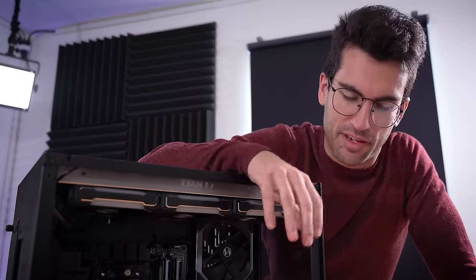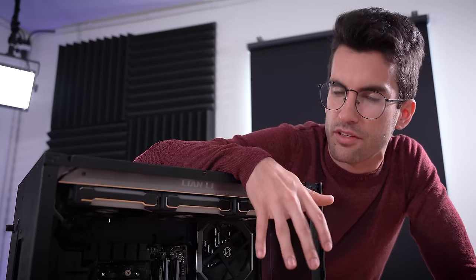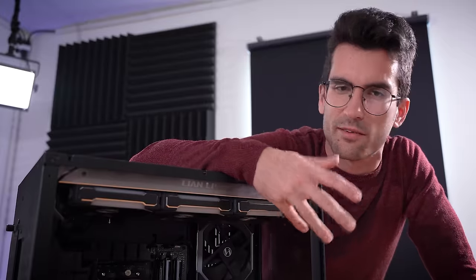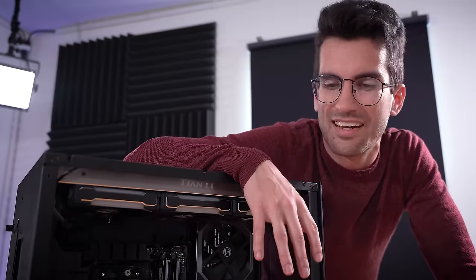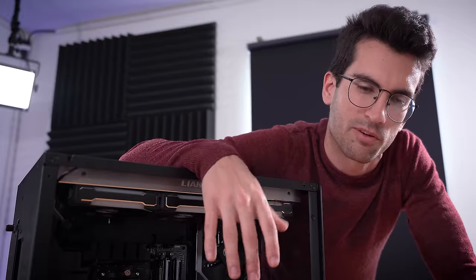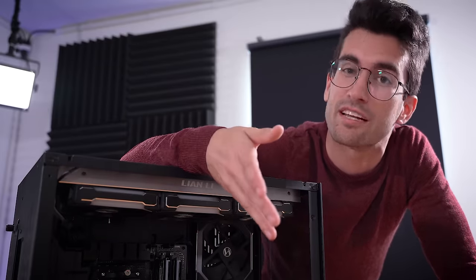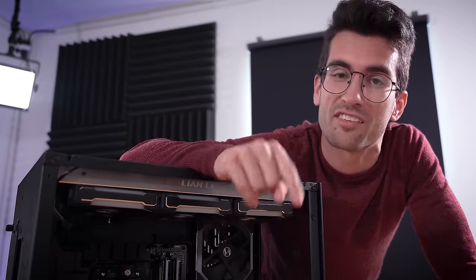Just something I'm filming as an extra after the fact. I did talk with the owner — he already replaced the original motherboard in here, but that didn't supposedly fix his issue, so he put the original back in, which was the one we were working with in this video. He said the one he replaced it with was an Elite Aorus, another Gigabyte motherboard. It's likely he might have miswired something there, or maybe damaged the socket when swapping CPUs. Either the board was DOA or it was some other simple mistake. That original board was giving him trouble to begin with — he was actually on the right track. He replaced the problem, it just ended up creating a different problem, and that was around the time he gave up on it.